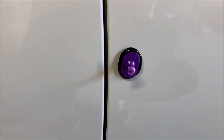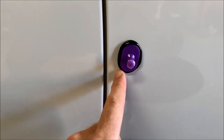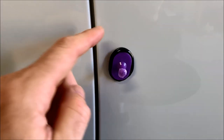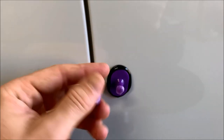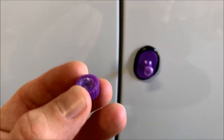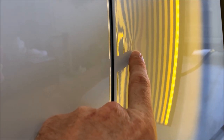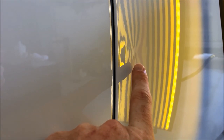I took a before and after picture on the other side, which I'll show in just a second. Over here, the tab actually broke off. I had put a little bit extra glue on it because I watched a video saying that if you surround the edges with more glue it will pull further before breaking — and it ended up breaking the tab. I'm going to use alcohol to get that off. What the broken tab did was actually pull the dent out great but it created a high spot — you can see this little hourglass figure where the black lines go into each other. I'm going to use the knockdown tool to flatten that out.